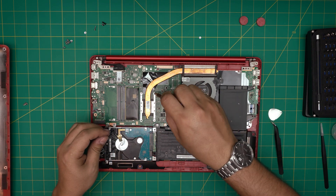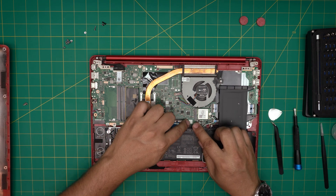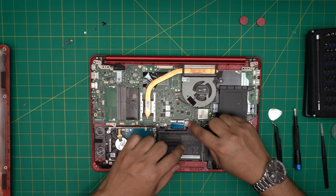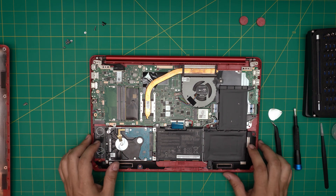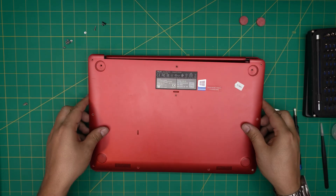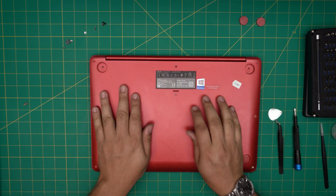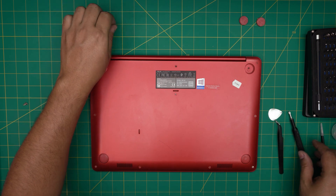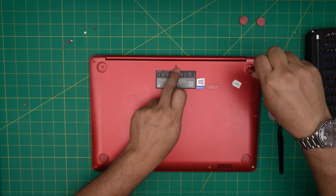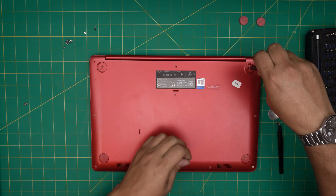Put the fan screw in the corner. Make sure the battery lock is back in position, place the battery connector down, push the lock over the jack. Grab the cleaned bottom cover, set it straight down, and push on the corners until you hear the clips click — at the mid-back, back, and front. Finally, reinstall all screws: black screws go under the rubber legs, the longest screw goes at the far back, short screws go in the front corners, and medium screws go everywhere else.